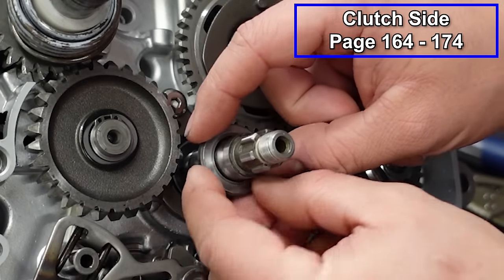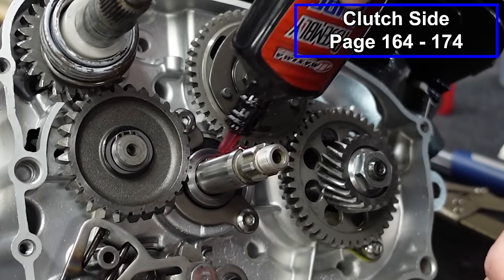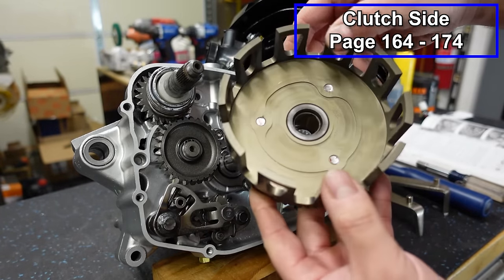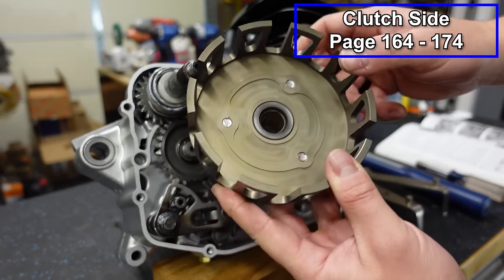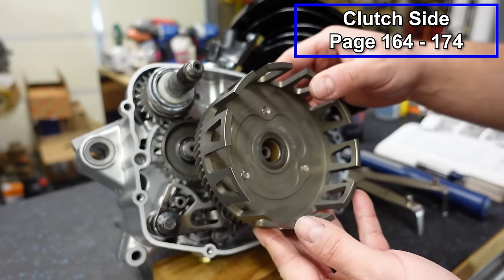This can go either way. That goes in front of the spring washer. Now I'm gonna put some assembly lube on our shaft. And next comes our clutch basket and gear. Now this is a billet basket. If you do want to install one of these and you're not sure how, I do have a video showing how I installed this exact basket. I will have that linked in the description below. This is gonna slide in place.